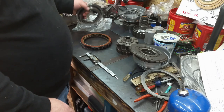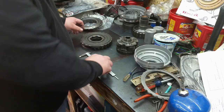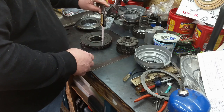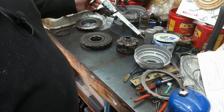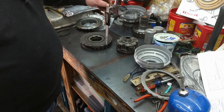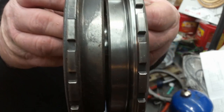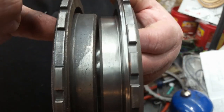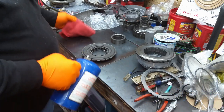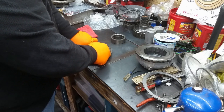This is why you have to check stuff, you guys and gals. Let's take this thick one out and put a thin one in there and see what kind of measurement we get - 29.6, and we're supposed to have 29.2 to 29.9. So that will be the one we're going to use. If you look at these two thicknesses up close you can see one has a thin and that's got a thick - the thin one gets us the measurement where we need to go, so that's what we're going to end up using.